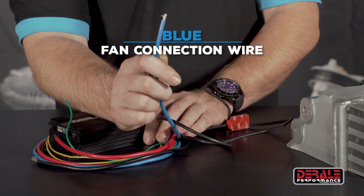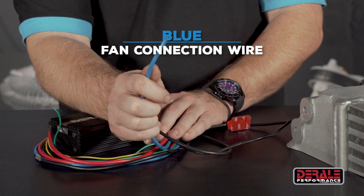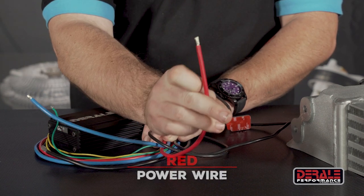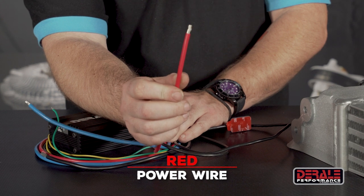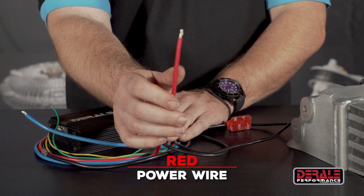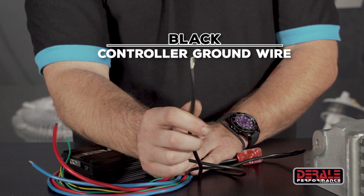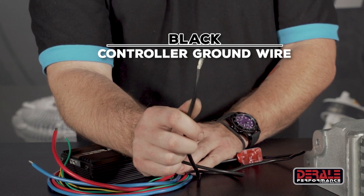You can connect as many fans as you want to this. You can use a junction block if you're doing multiple wires that stack up and get fairly thick. We have our red power wire, which is pulling power from the battery. We want to avoid the starter and alternator, which can basically kill the controller because it's unregulated voltage. And then we have our ground wire for the controller — a basic chassis ground, engine ground, anywhere you're getting a good clean ground signal from.